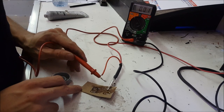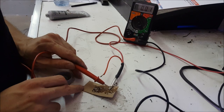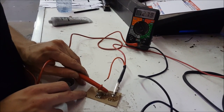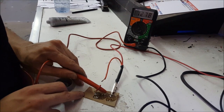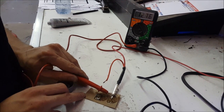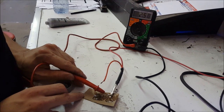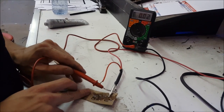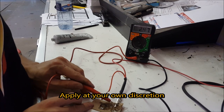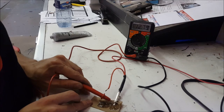We stated that dielectric grease is an insulator. Now let's see if we actually lost any voltage on the alligator clip itself — touching it again. We have no degradation in performance. We actually see a slight improvement at 12.78. So the argument that it makes the connection worse — based on this, we can say no. It would be okay to put it inside a connector if you felt you had to. The grease by itself does not conduct, but on contact-to-contact like an actual electrical connection, it actually looks pretty good for it.